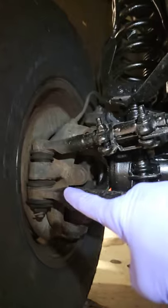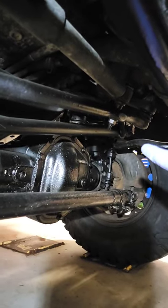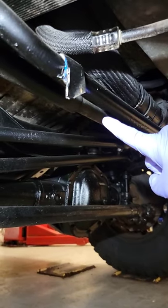This is a simple front end check that will tell you if any of your steering components or linkages are loose. This is one of the most common things that we see that causes the death wobble — these linkages. Also, when you have it off, double check your steering stabilizer.